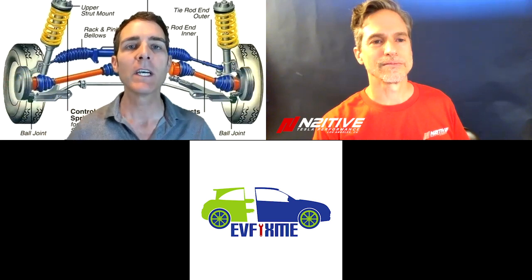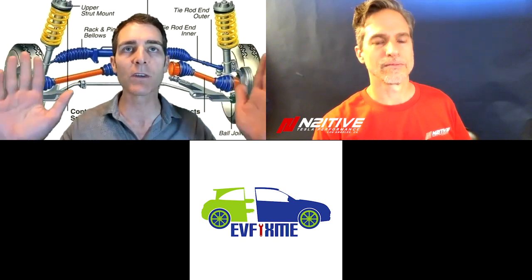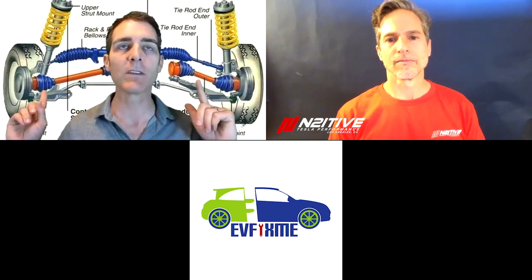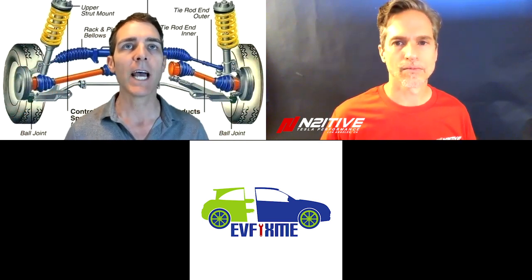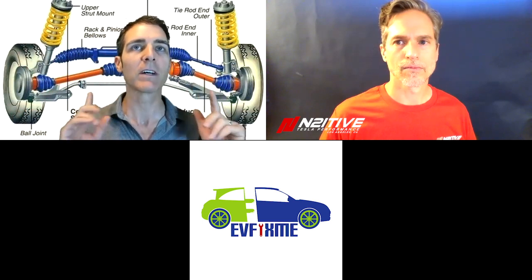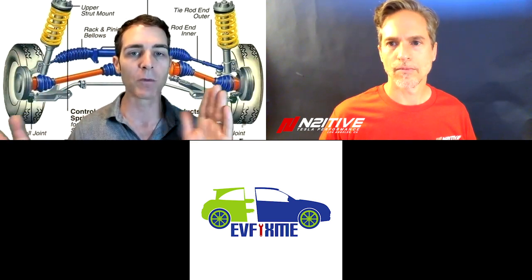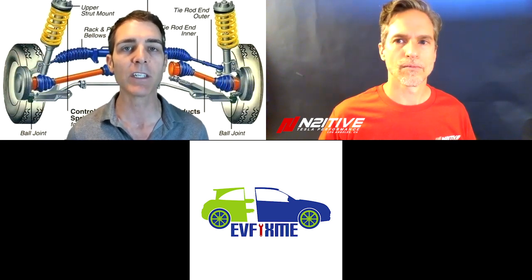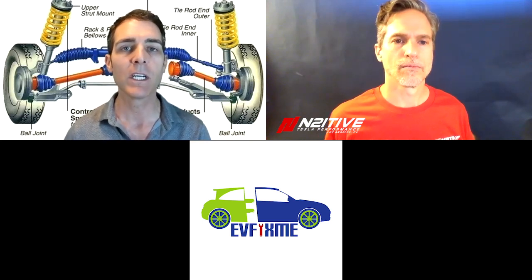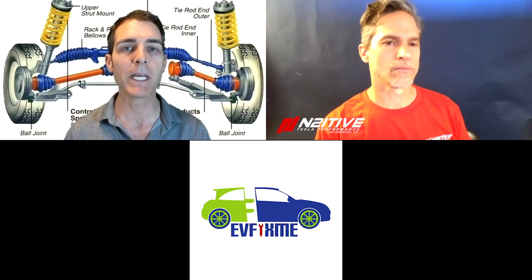I have a diagram here showing a general setup for folks that aren't completely familiar with how this front drive system works on any front drive car. You have to steer those tires left and right. So you've got these half shafts, which are CV joints. The red straight lines are the axles, and where my head is, is where the electric motor would be on a Tesla. You've got two joints covered in blue in between the red axle and they have to pivot and go up and down and turn with the wheels. The problem is that there's so much of an angle in there — so many changes — that it's actually out of specification from the way that the axle or CV joint manufacturers have designed these parts. You get some kind of pitting in there, some kind of imperfections, and then it causes a vibration that never gets better; it keeps getting worse.